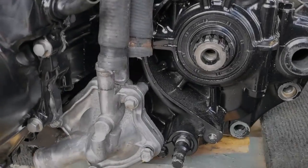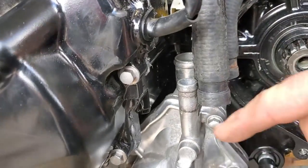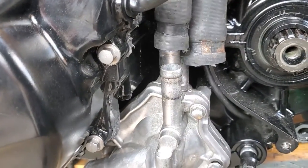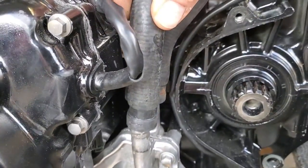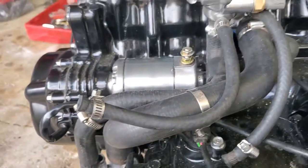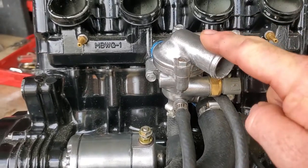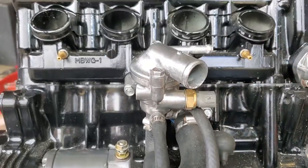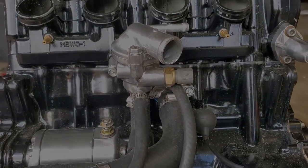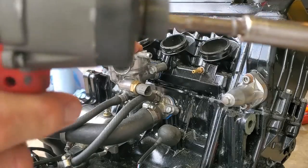I'm going to go from here under the assumption that you don't really care to see me unscrewing hose clamps anymore, so I'll just tell you I'm going to do it and then do it off camera. In this case I've got both of these hoses off that run up here, so we are free to go ahead and start taking these two housings off of the engine itself. I'm going to take these bolts out — these housing bolts, all four of them, there are two here and two here, and they are all standard 10 millimeter.